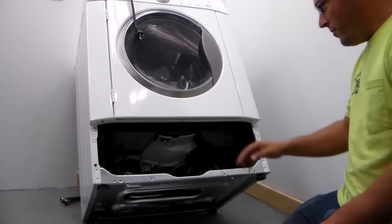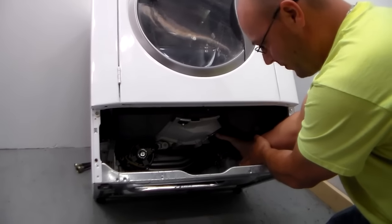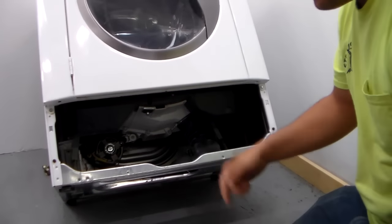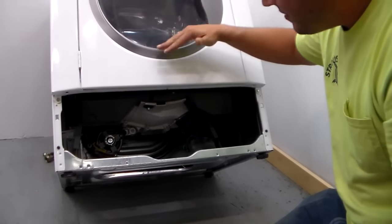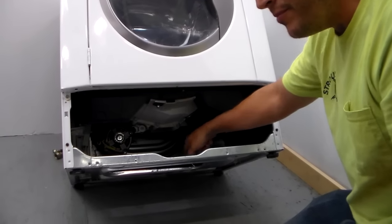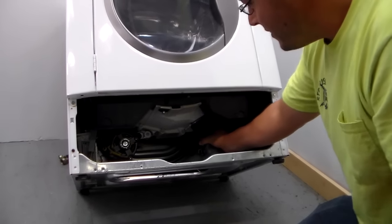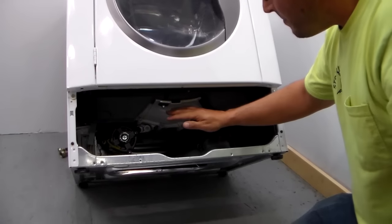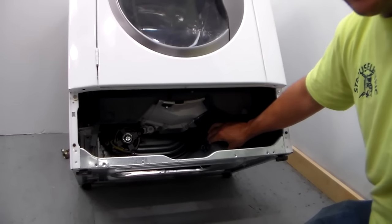The piece we're going for is inside the machine. Coming off the tub you have a big rubber boot, and inside this boot is a plastic tube with holes in it. That's going to stop coins and objects from your pocket that slip through the tub — they get down inside this tube and it stops them from going into the pump and breaking the impellers. A lot of times the repairman will clean out what's inside here and your machine will start draining again. You might have a baby sock, a small pair of underwear — who knows — but this is the first thing you want to remove when cleaning out the drain pump.